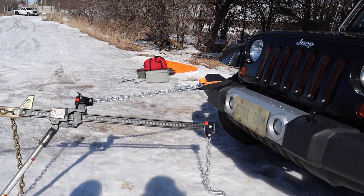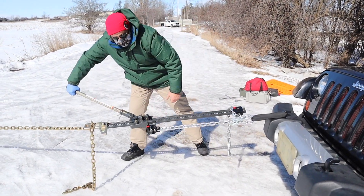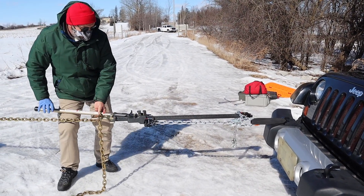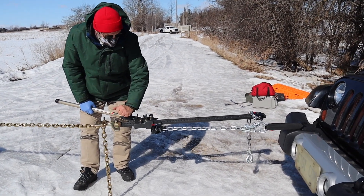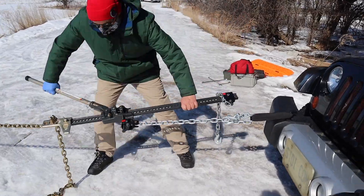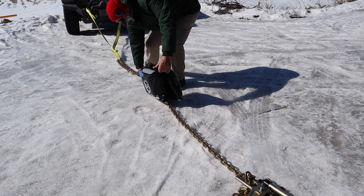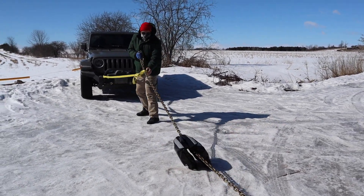Eventually you get to the point where you've cranked the Jeep close to the high lift jack, and you'll either have to invert the jack so that you don't hit it and continue jacking the Jeep in, or you'll have to adjust the chain. When you've jacked the Jeep in as much as you can and still need to keep cranking, it's time to loosen the high lift jack and reconfigure the assembly. The tow chain can be brought in at different locations, but that's why you practice this sort of thing — to find which way is most comfortable for you.